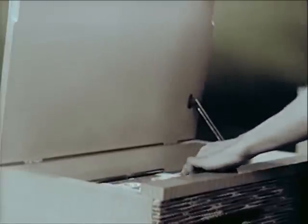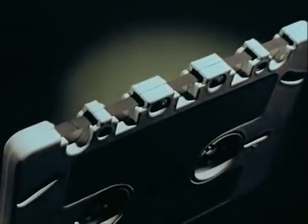But that's only part of the story. The new cartridge cuts basic tape costs to one quarter of what they used to be for the same playing time. The old reel-type stereo tapes carried two soundtracks, one for each speaker system. The new cartridge tape carries not just two, but four tracks — two in each direction for stereo, or four tracks for monaural — giving twice the playing time for the same length of tape.